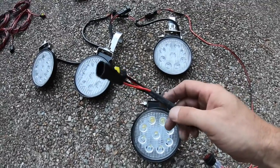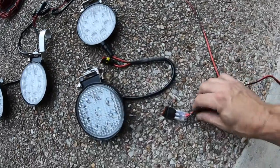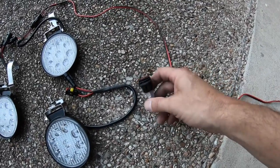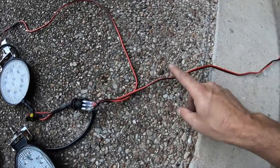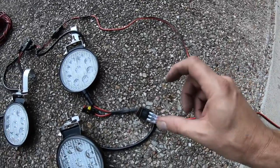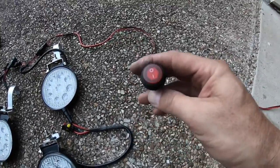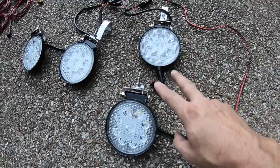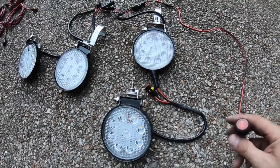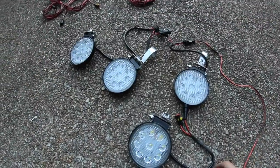The way I've connected these together they're in parallel — if you don't know what that means, it's basically red to red, black to black. I have this switch from a previous light that I never used, and this wire is going all the way back up to the battery connecting to that other little loom. I'm going to snake this in the tent at night and have a couple of these lights on top of the rack. If I hear something at night I can flick the switch and see what's going on.